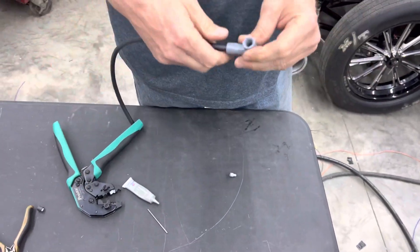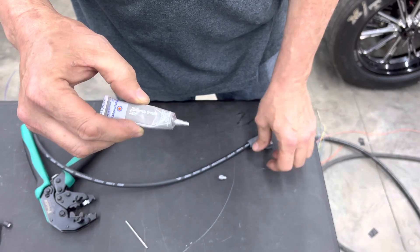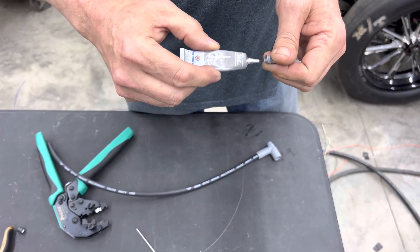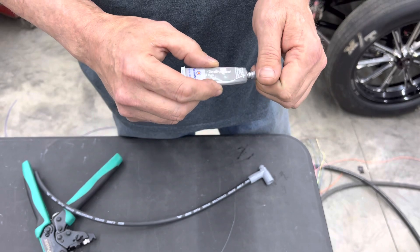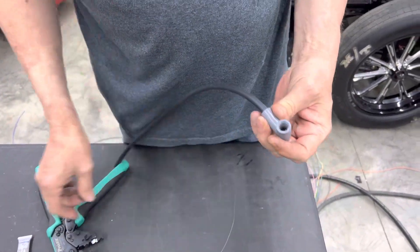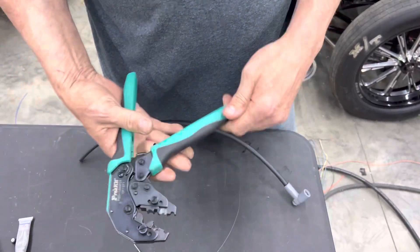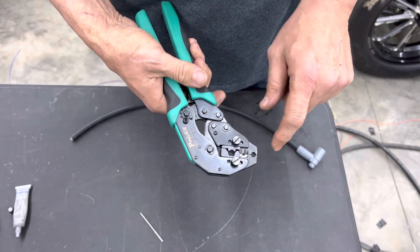So that was today's tip — use this grease. I don't care whose wires you run. Wire manufacturers will tell you the same thing if you call them up and talk to them. It's very important, especially on a high-energy ignition system. And when you crimp the boots on, use the extra crimp inside. That's why it's on the tool. There's two crimps that need to take place. That's all for today — we'll see you next time.